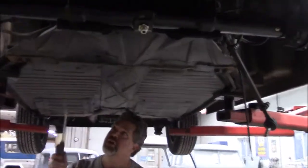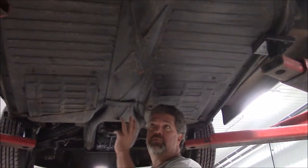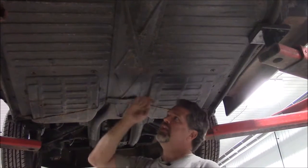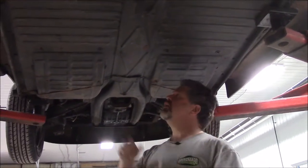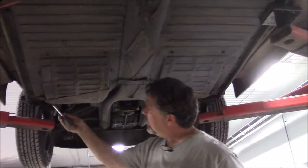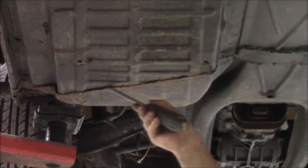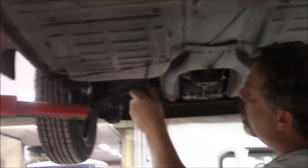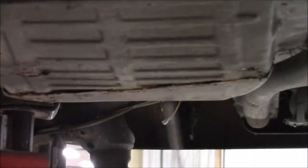As we come back further, these are original Volkswagen Beetle pans. Because it's a kit car, things like these Porsches with a shorter wheelbase and also dune buggies — the tunnel and the floor pans need to be cut and shortened, depending on the kit, anywhere from 10 to 12 inches. With this Beetle chassis, they did the angle cut, which is correct — you can see along here where they've trimmed this off, and same thing on the driver's side, cut on an angle, which we like. But what we really don't like is all of these exposed hunks. Structurally, this is not welded properly — this is kind of bubblegum welding.